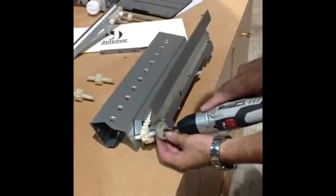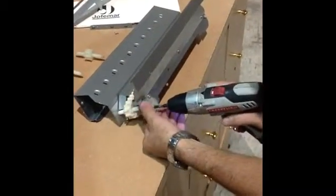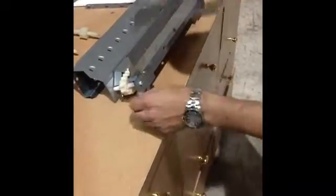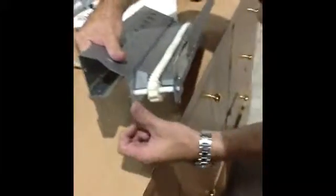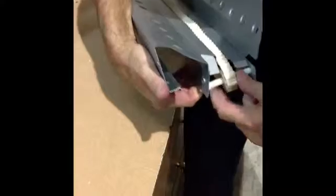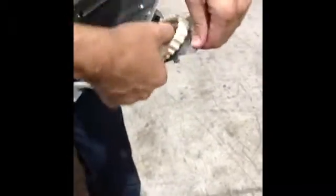All we have to remove is one Phillips screw. We remove the screw and remove the gear, keeping in mind we're going to use the new ones supplied with our order. All we have to do is pull on these two metal tabs to disengage the part from its housing — let's do the left side. The gear will slide a little bit awkward out of position, but it'll come out fairly easily.